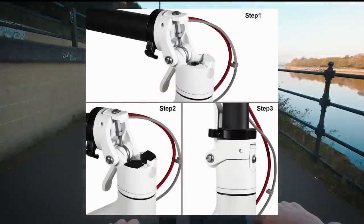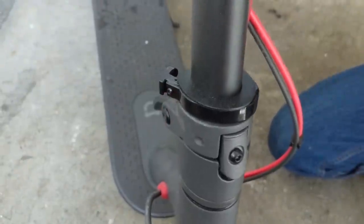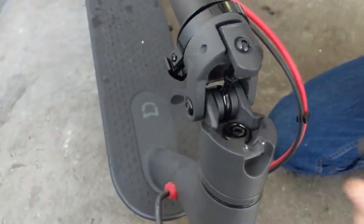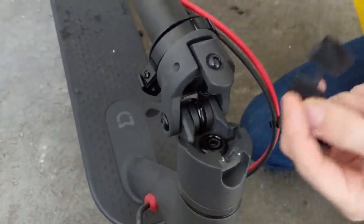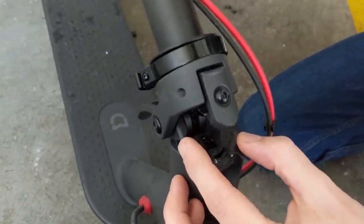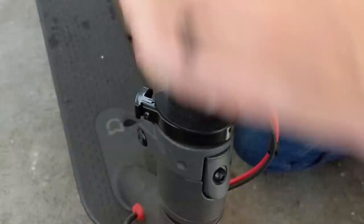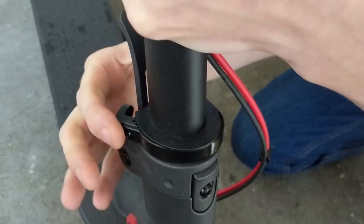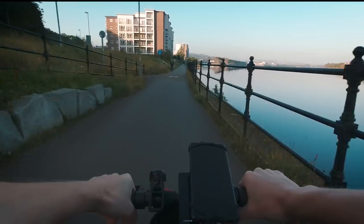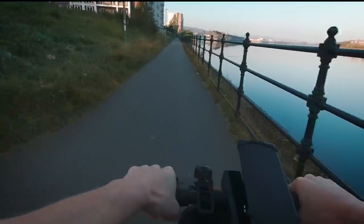Just insert it and clamp the hinge down. Be careful not to select too thick a damper as it may lead to overtightening the latch, which could potentially cause a catch failure. But if your scooter is developing rattles for the very first time, you'll probably find that the 0.4mm or 0.6mm is enough.